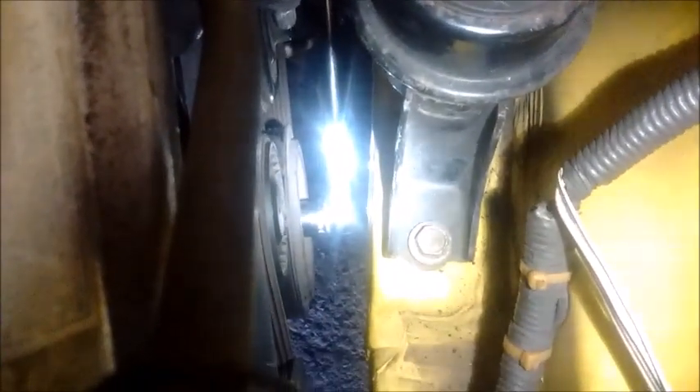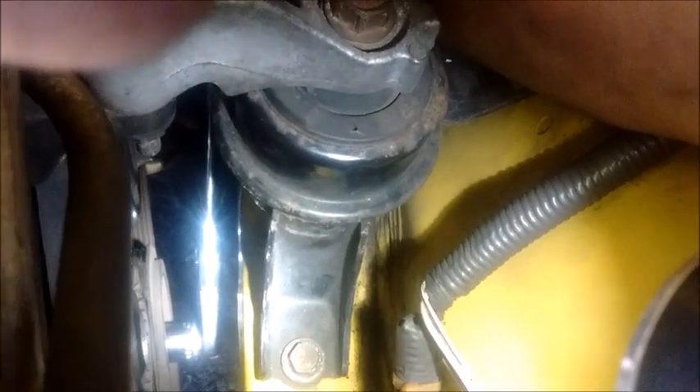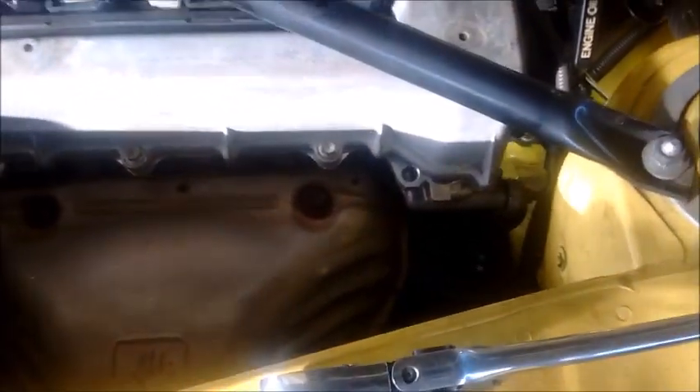We are peering down at the crankshaft pulley, and I've put a 19-millimeter socket on it with the wrench. I'm going to turn it back gently — just jog it back — until I hear a click, which means the tensioner latch has released. Done — I just heard the click. The tensioner is back in and we're all good with our chain tensioner replacement.